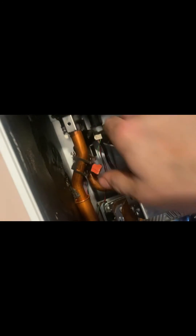Watch how it's straining. There's a little C-clip just at the side of the sensor. You can push it from the other side with your finger around there so you can get a screwdriver in, but I tend to use a pair of offset pliers. There's your C-clip. And there it comes, which just leaves the sensor itself - give it a little wobble.